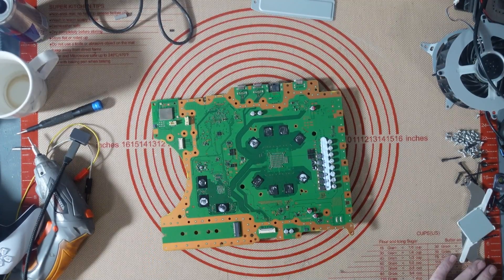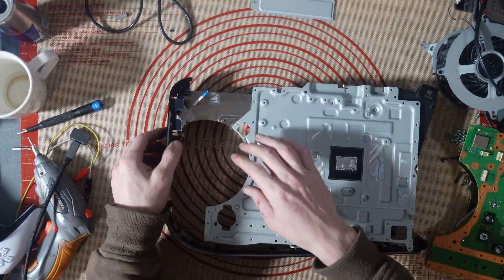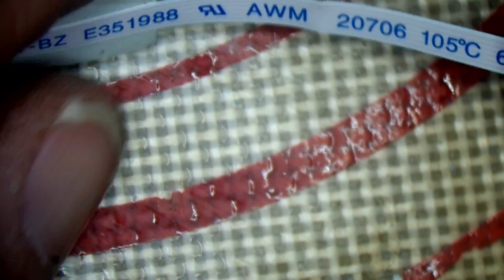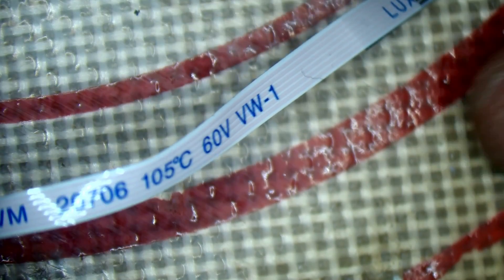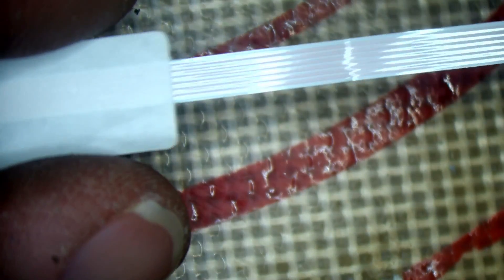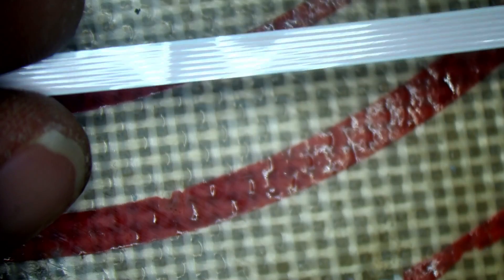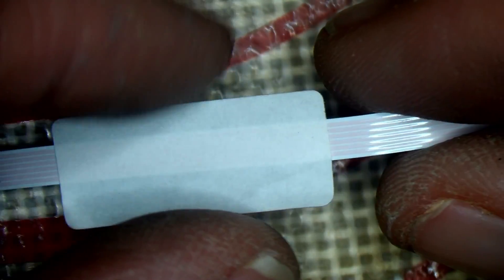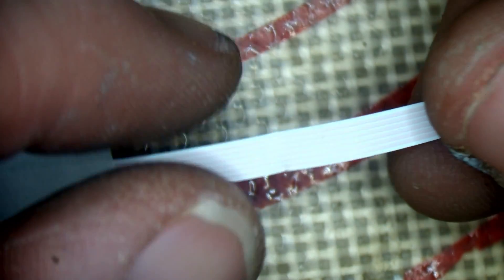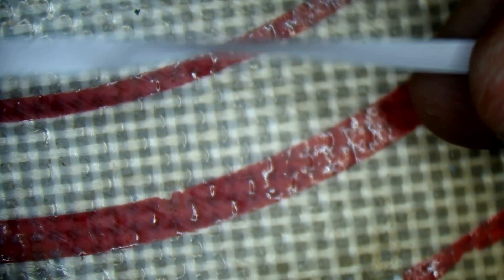There is one thing I want to try. On the PS5, sometimes we get a triple beep of death caused by a bad LED cable, so I want to inspect the LED cable and actually have a look at it properly. The LED cable looks okay. A lot of the time when we've got this issue we see a ring on the LED cable which causes a triple beep of death normally as soon as it's booted up. I don't think that's the case on this — there's some slight pinching to it but I doubt that's the cause. I can try another LED cable just to make sure, and I think I will do that before I go any further.